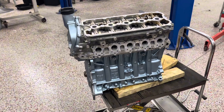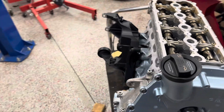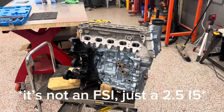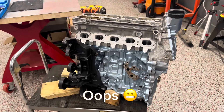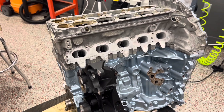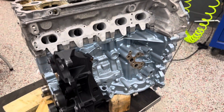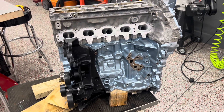As I've said many times on my channel, this is a Volkswagen 2.5 — a five-cylinder, more commonly known as the 07K because that's its code. Some people might also call it the 2.5 FSI; I think that's the more technical name. And it is a dual overhead cam, four-valve-per-cylinder layout, as with a lot of modern cars. The block is iron, and that's how Volkswagen has really always done it, up until modern times.